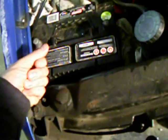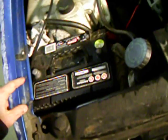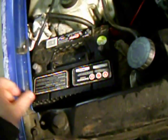In this truck, the battery is right here, the common terminal is right here, and the positive terminal is right here. It's also got double terminals — there's a positive and the common is under there. The reason why the common is always towards the firewall, or it should be, is if you're using a wrench and it touched the fender or some part around here, you're not going to weld the wrench to it. If this was the positive terminal and you used a wrench and hit the fender, you'd be welding.